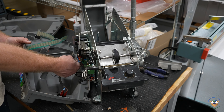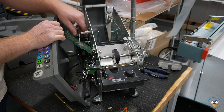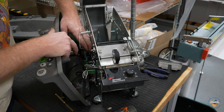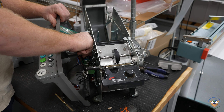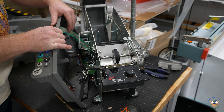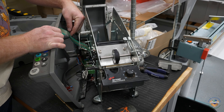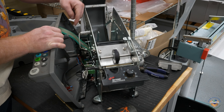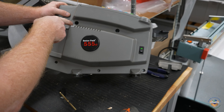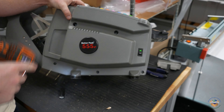Now we're going to get our side frame back on. Plug in your power supply. With these keypad ribbons, I'll go behind the magnetic proximity switch and start with the rear one first, making sure I cover all those pins, then the front one. Before you close this side frame, make sure these ribbons go behind where the screw goes — what you don't want is those ribbons blocking the hole so when you drive that screw in you drive it through the ribbons. I kind of hold it as I set it on there, then look down into that hole to make sure you can see through before you drive the screw in.